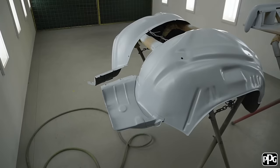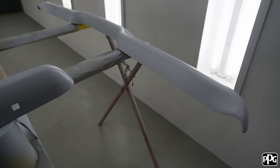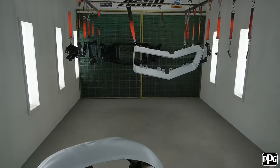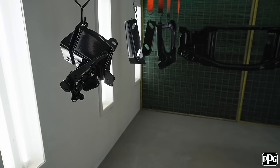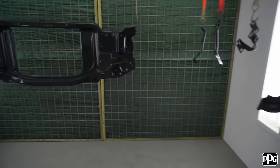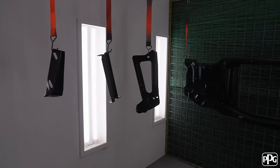I've double-teamed up here — I've got black primer and white primer going. The white primer is a high build primer I'm putting on the bumpers, which were pretty rusty and average and have been all bogged up. I've used the high build rather than the spray poly and they're looking pretty slick now. I've also stripped the chrome nose cone back to copper and put primer on that. These other parts are getting the black wet-on-wet primer in the Delfleet range — it's an F4949. I haven't used it before, it's a bit of a trial, but so far so good. It's looking really nice and we're going to use the Delfleet black over this and on the chassis as well.